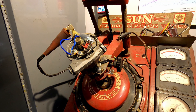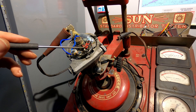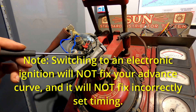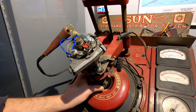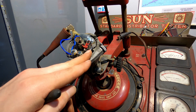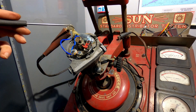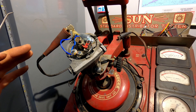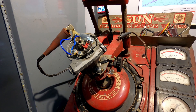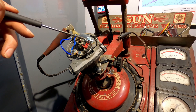The easier thing you can do is toss in an electronic ignition. The whole point of an electronic ignition system is basically to replace all of this. You don't need the condenser, you don't need the points, because it's just an electronic means of opening and closing a contact. With points, it's a mechanical means — it's either touching or it's not — and that depends on the mechanical pressure from the spring, the quality of the contacts, whether the shaft wobbles, and whether the condenser is doing its job.